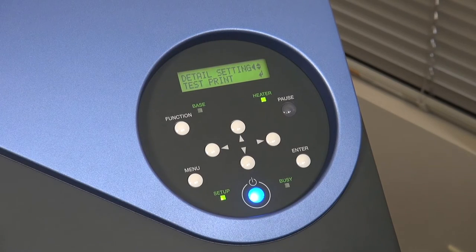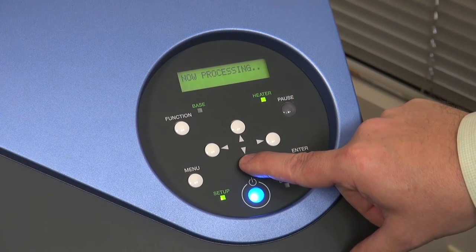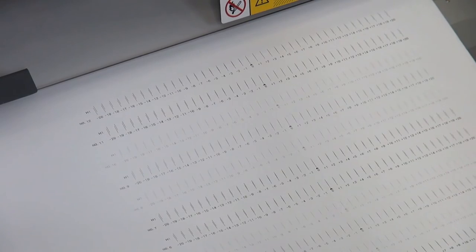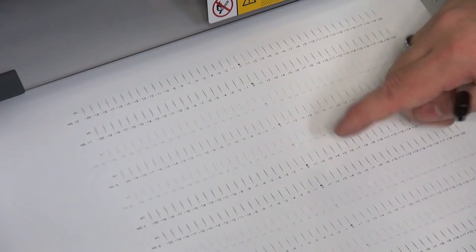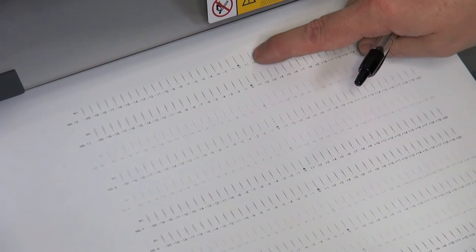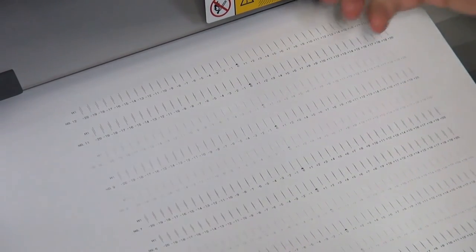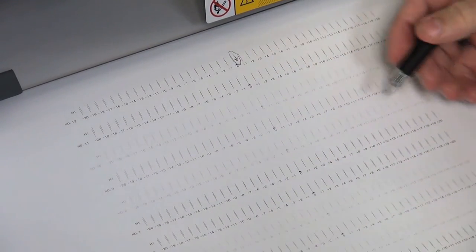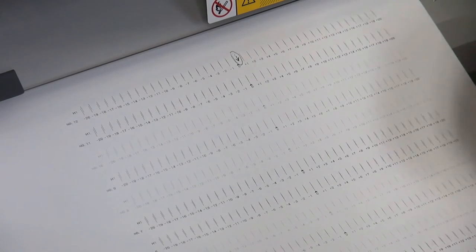When the test print is complete, get out of the menu and use the down arrow to advance the media out so you can inspect the print to see where the settings are at. Inspect each line as we did in the simple setting, looking for the value that reads the smoothest line going across and looking at the triangle to show what it indicates. In this one I can see it's not quite where I want it — the plus one is maybe a little to the right, so the value is in between those two. I find it useful to use a pen and circle the area I want for the value, so that when I go back into the menu to enter them all in I can visually see where each one is, making it much easier to enter.